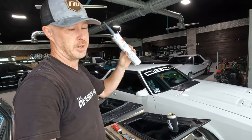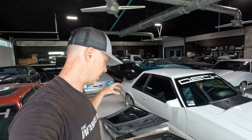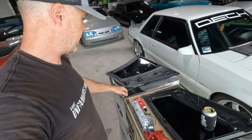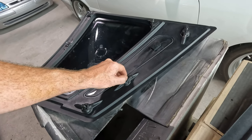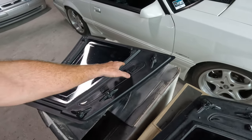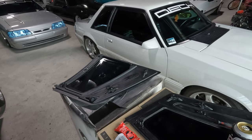In the end, I went with 3M Window Weld windshield urethane. If it's strong enough to hold your windshield in, I figured it'd be strong enough to hold these studs and adhere to whatever rubber compound they use for these quarter windows. I put it on, spread it around, made sure to squeeze any air out, and it is solid. Before, I could rip those studs out easily; now I can put tons of pressure on everything. I think these are going to be okay. I'll make sure there's a good seal all the way around the quarter window area so we don't get water inside the car.